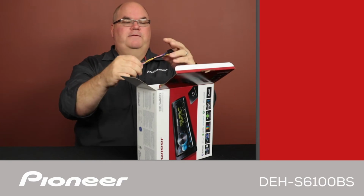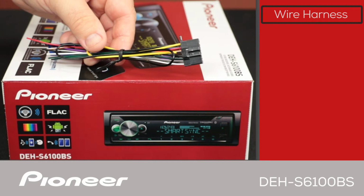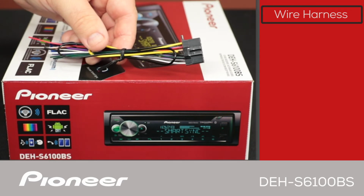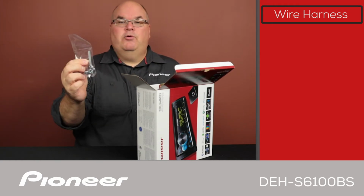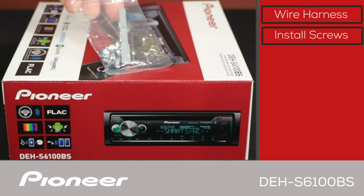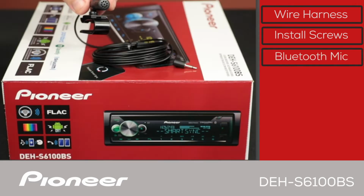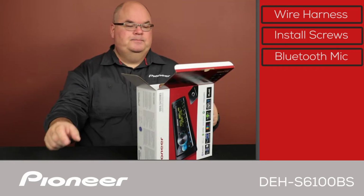All right, we're going to start off here with the wire harness. Now, the wire harness here is used to connect power, ground, speakers, and all of the electrical connections from the vehicle to the in-dash receiver. Next up, we have some 1-DIN radio removal tools and some installation screws. Next up, we have the Bluetooth microphone. Now, the Bluetooth microphone here comes on a wire around 10 feet long or so for a very flexible installation.